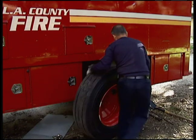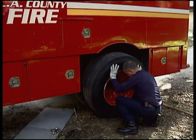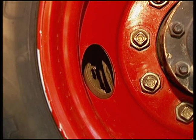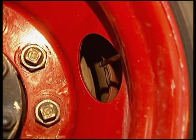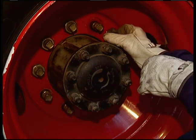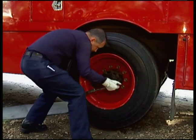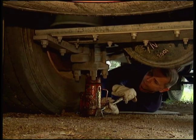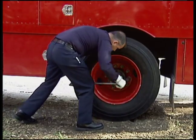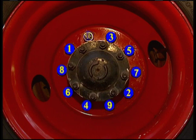In the same fashion as the inside wheel, mount the outside wheel with the concave side facing outward. Use a tool to lift the wheel onto the studs. Make sure to align the handholds of the rims with each other, and the valve stems should be on opposite sides. Reinstall outer lug nuts and hand tighten evenly. Lower the vehicle and remove the jack. With the vehicle on the ground, finish tightening outer lug nuts in a criss-cross pattern. Remember to re-tighten lug nuts to factory specifications within 100 miles.